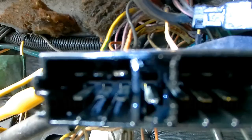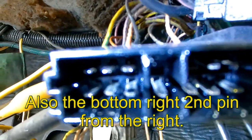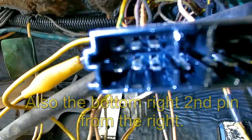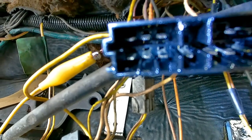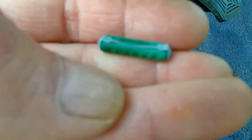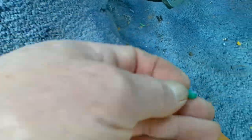All the top left pins are hot and one top right pin is hot — giving 12 volts. And the other ones are not giving 12 volts. So what I'll do now is take out the fuse that goes on the circuit board that feeds the rear view lamp and see if that affects the 12 volt on one of these pins. Okay, I want to take out this one here — this green fuse — because that's the one. And this is the fuse to the reversing light on the original circuit. So let's see what happens then, see if that affects those pins under there.